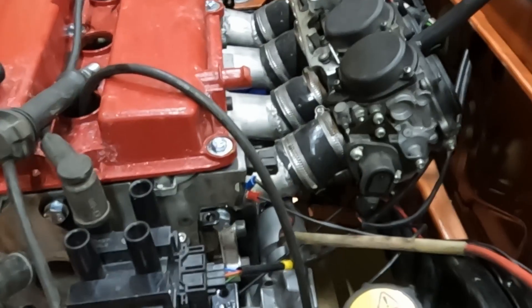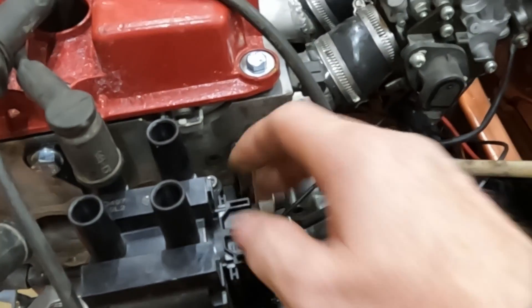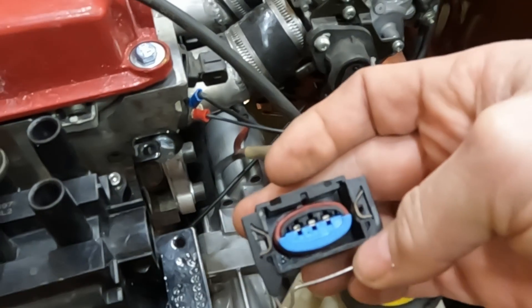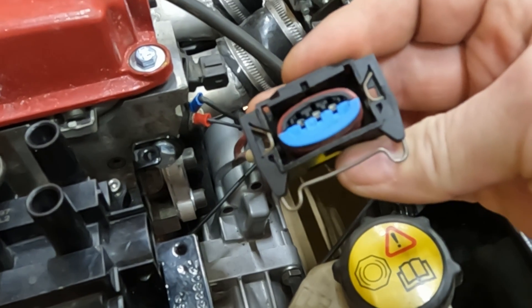After that we go all the way down to where the crank sensor is. Again, this is simple plug and play — with it being a Ford engine I'm using the standard Ford crank sensor. It takes the signal off the back of the flywheel, telling the ECU every time the flywheel passes top dead center. When I started fitting this system, the one problem I had was that I couldn't get the coil wire through the bulkhead hole.